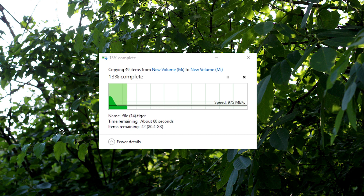The first test is a simple file copy test with a folder of around 92GB of raw data copied on the same drive. This shows the actual speed in daily use. It's interesting to see the speed dip from 900 MB/s to close to 600 MB/s — this is the point where the cache fills up and can't keep up with the storage demands. You can literally see the write bursts as the cache tries to maintain a constant speed.